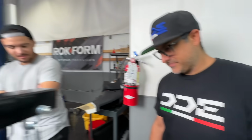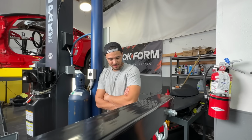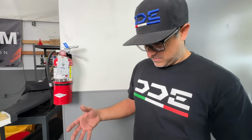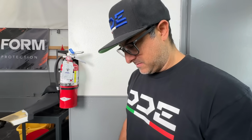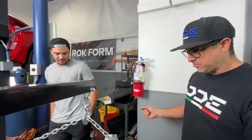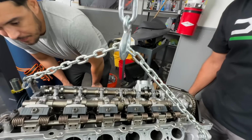Like a missing O-ring somewhere. Does he even use it on the pickup or something? No, because it had oil pressure. It had 80 pounds of pressure. So the bottom end should be fine, I think. We'll see. There's another crank, because when the other crank got decked, some debris got into it and plugged up a tiny little hole. I don't know. I mean, it's got to be something dumb like that.